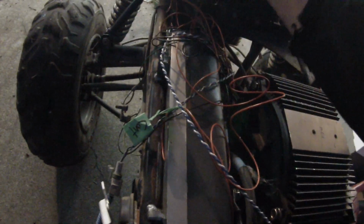My fuse is actually arcing there, so I think I got a loose bolt. I'm gonna put it in low range so there's low load on it. I actually saw it happening. Get a load of that. Probably decided it doesn't want to go anymore, so we'll give it one more try. Yeah, it doesn't want to go anymore because there's something wrong with the way that fuse is connected.